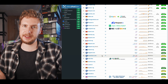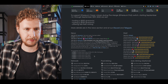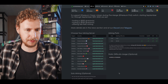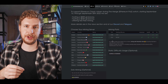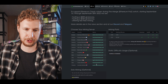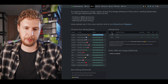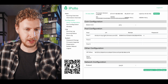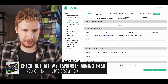You then need to find the stratum address and port number to be able to connect to the pool. Most pools make it very easy to find these things, usually under a section called 'how to connect' or 'start mining' or something similar. If you click on Hero Miners, there's a little icon that says start, and here we get all of the information we need. Hero Miners actually has servers all around the world to make sure your connection will be as fast as possible. I'm going to go with the Germany server, so I'm just going to copy that stratum address. And then we have the port number — after that, we go back to our iPollo interface and enter all of these settings.